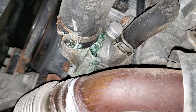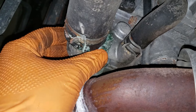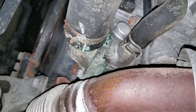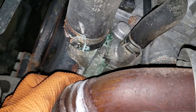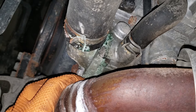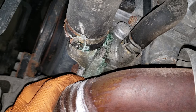With the coolant continuing to drain in the background, what you can see here is the leak from the thermostat housing. Most of the leak is happening from the radiator hose itself. What causes this situation specifically is when the acidity in the system starts to build — this is a lack of maintenance. Unfortunately with Subaru and their maintenance schedule, they've been trying to get more cost-friendly for their owners. This sort of thing can easily be prevented if it's recommended for service by the dealer, but Subaru of North America hasn't always been recommending CVT transmission service, and they've been upping the oil change intervals.